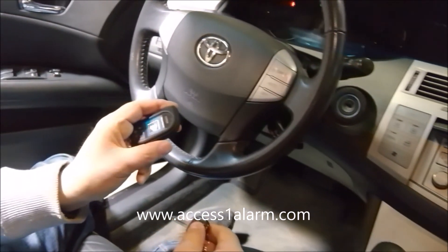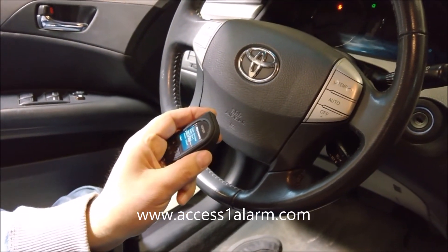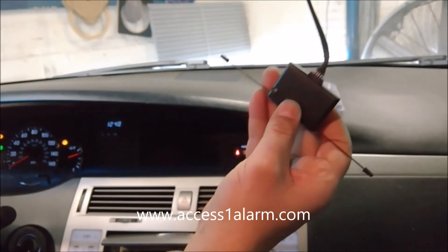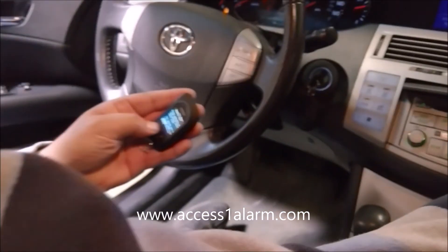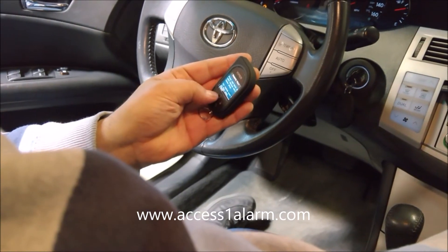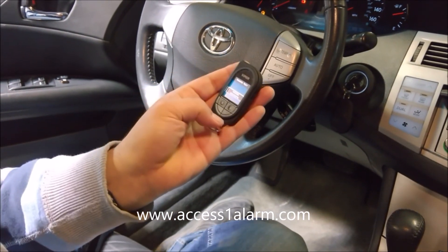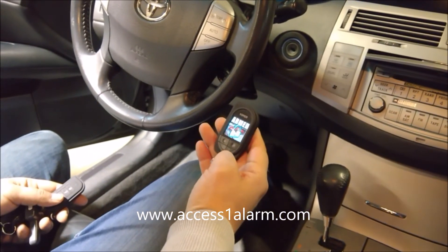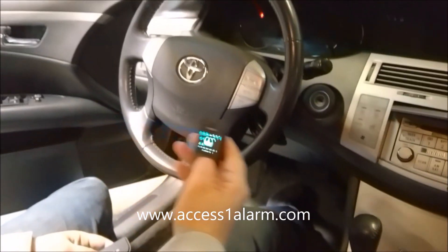Go to steps, adjustment, remote pairing. Turn the key on with the new antenna, press 1, hold for confirmation, then press and hold. Remote pairing is successful and the remote now works — lock doors, open.